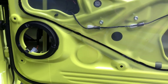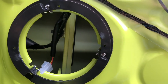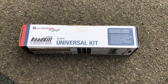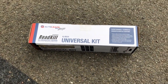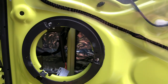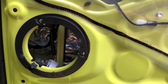One of the other things I'd really like to do to improve sound quality is to use some sound deadening material in the door. However, given how much of this door is covered, that's going to be extremely difficult. I'll try to put some sound deadening immediately behind the speaker, though I'm not sure how much effect that will have in isolation. The sound insulation material I've got is fairly standard industry stuff — quite heavy actually — a self-adhesive material that we're going to stick to the inside of the door. I've managed to get some into the door panel and covered much of that inner panel at least behind the speaker.